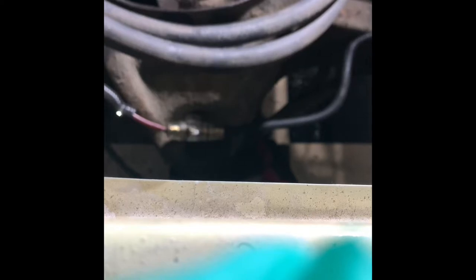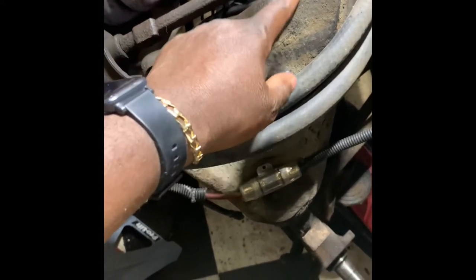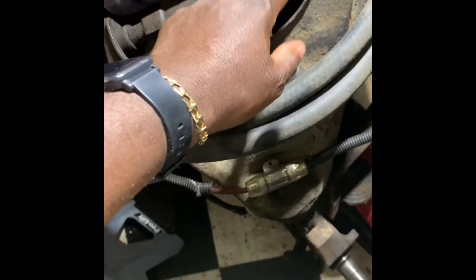I'm jacking up the vehicle right now, and by doing this I'm placing tension on the spring while at the same time the control arms come up. Be careful here — this is dangerous. As you can see, as I raised the car up the upper control arm unhinged itself from the joint bracket where it is.